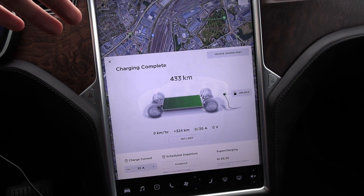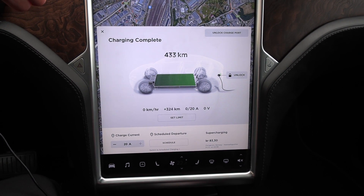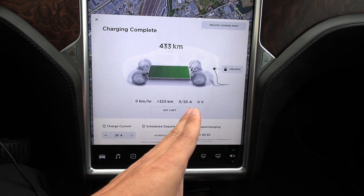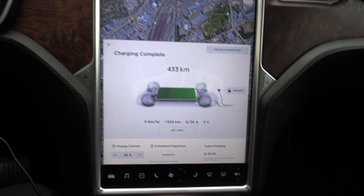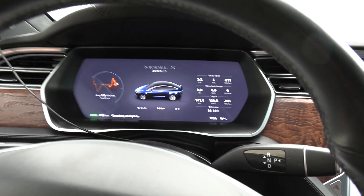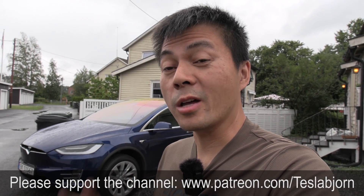We can't just look at one case and say this is it — it's not statistically significant. We need at least 50 cases before it becomes significant. But I have to say, when I enter here and start looking at numbers, this is really impressive that the car has so little degradation. What we can't see is how did they charge — did they charge to 100% a lot? We don't know, but maybe it doesn't matter. Maybe what matters is that the car didn't fast charge or supercharge a lot. This car can take 140 — it peaked at 144 kilowatts when we were charging it, so it still charges pretty fast. Four-year-old car with so little degradation — this is almost unreal. Anyway, I think that's going to be it for this episode. I hope you guys enjoyed this video. As always, thank you for watching and talk to you later.